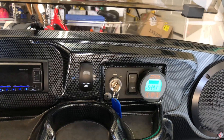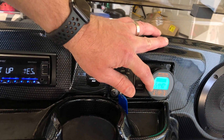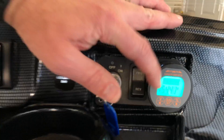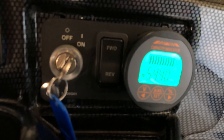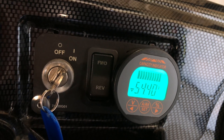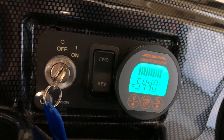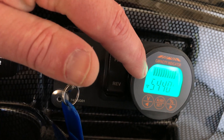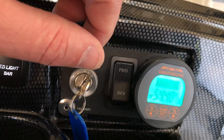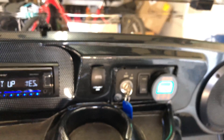This is way better than just reading actual voltage to see how many miles you have left. When it has that little down-arrow triangle, that means you're using power. If you use regen braking — like when you let off the gas pedal — or you charge it up, you'll see a little up arrow and it'll put energy back into the battery. This meter is only about $40 on Amazon and is super handy, especially for lithium carts.